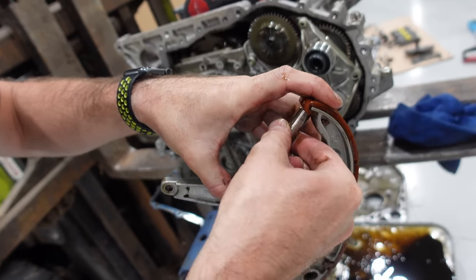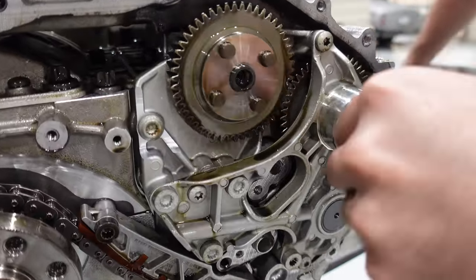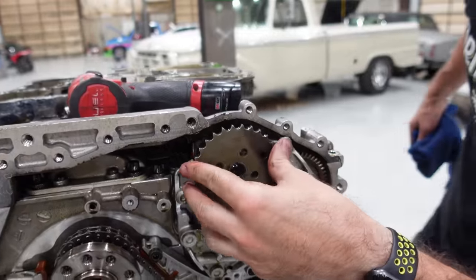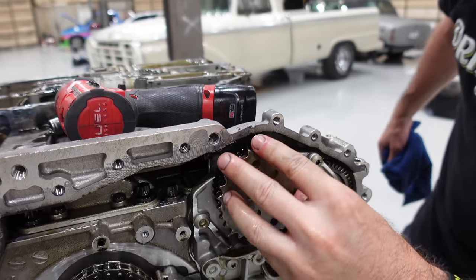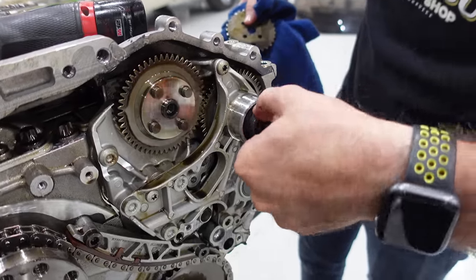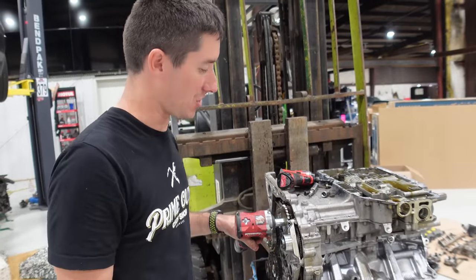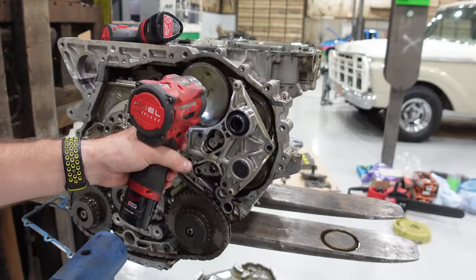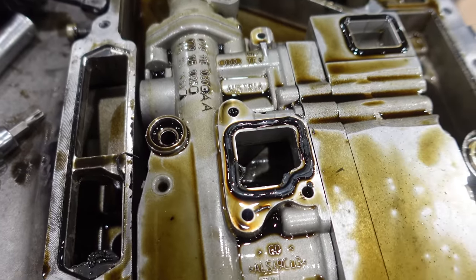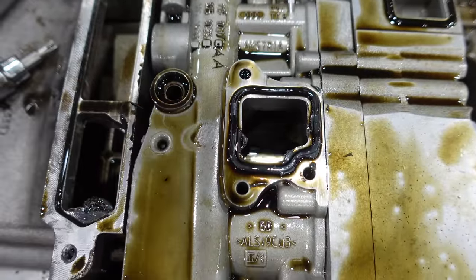There used to be a way to pin this — if you push this back in you can put a pin in right there to keep that tensioner locked. This is the gear drive that runs the oil pump. As soon as you pull the pulley off, you're no longer driving the oil pump — so if we put that back and put the bolt back in, there goes the oil pump. This is the oil pump drive, and all these other gears are driving the AC compressor and the other output off the back. You can see some really cool gear mesh in there. Super nice. The impact just took right off and started running it like it was the engine — take a look at this thing running. You can look at the oil pump running now and see the auxiliary shafts, probably a counter shaft, and what looks like the main oil pickup.